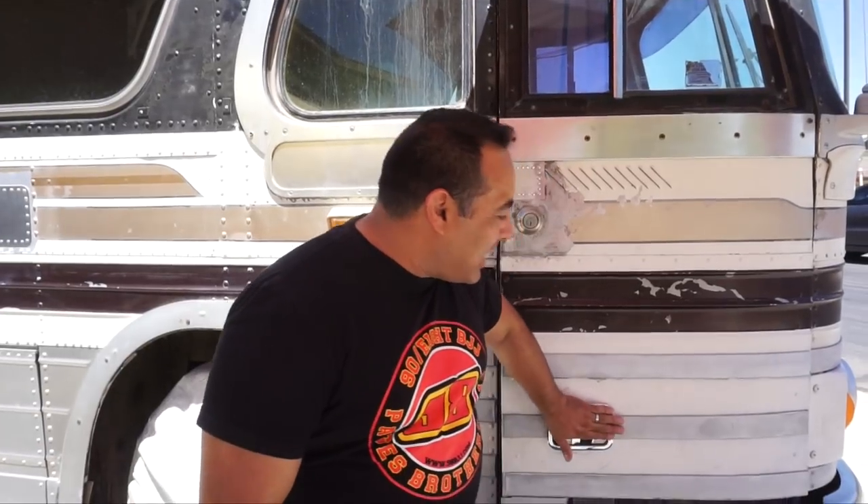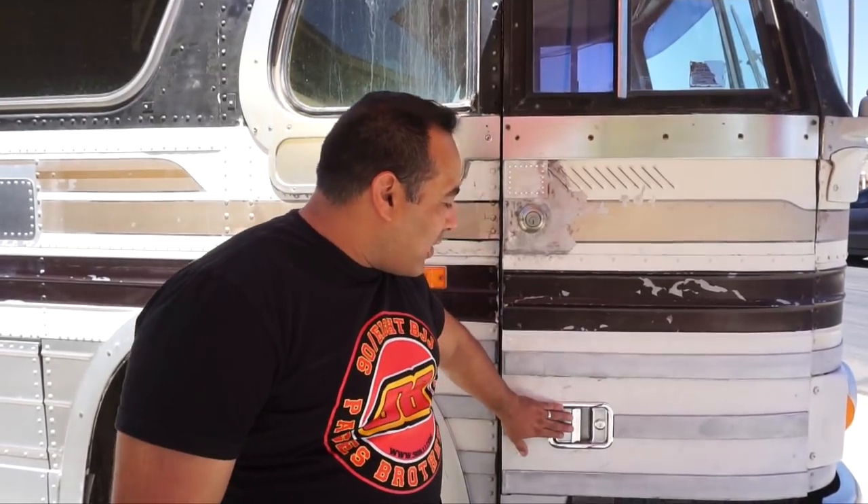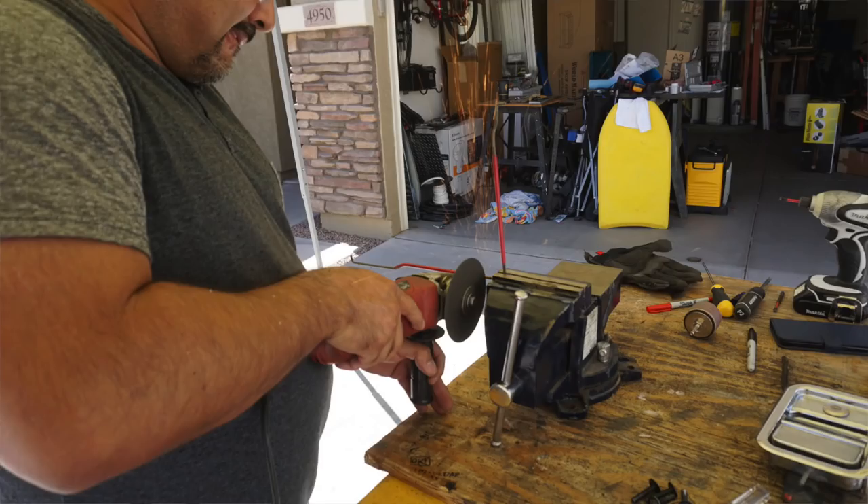Next we had to put it in. The way this lock is designed, it's meant to go below the clamp because in a big rig the handles are way down at the bottom of the door — in the corner, so you open it and then climb in. For us that meant moving our handle much lower. The full rod length wouldn't work, so we had to either make a new rod or modify the existing one. We modified the rod length to get it to work.